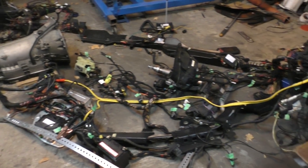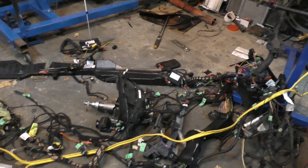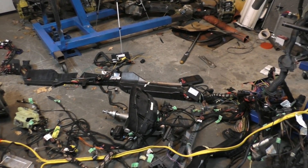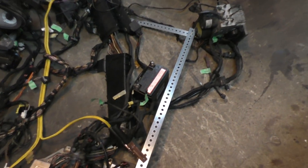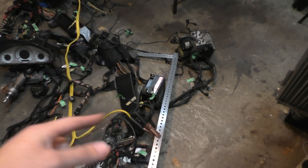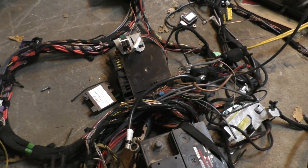After a few hours, I've connected everything exactly like it would go in the car. There's the engine, the ECU, the instrument cluster, the steering column — pretty much everything. The only things missing are the ESP module, which someone borrowed, and the door modules, which I cut off since there'll be no doors, no windows, and no door locks on this car. There are actually two batteries — one in the engine bay and one in the trunk. For all the grounding points, I've used a metal strip as the chassis ground.